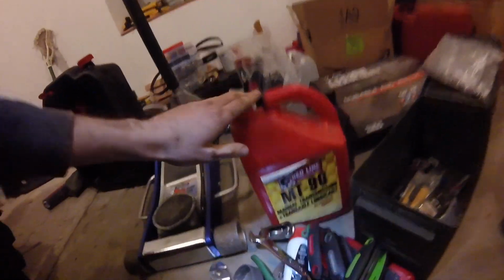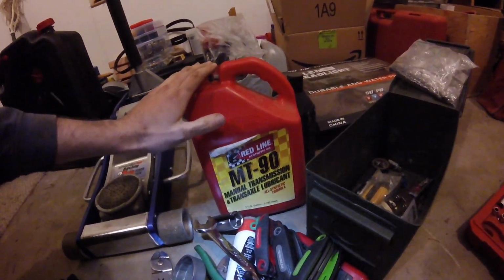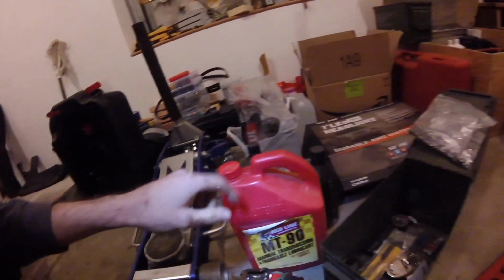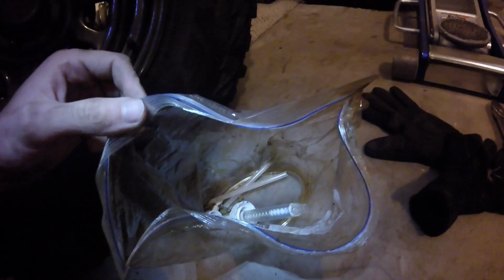So I'm using Redline MT-90. Also, I'll include in the description the part number for the MOPAR fluid. And so basically you're just going to drain it, pour it into a catch can, and then fill it back up, and the only thing you're going to need is a bottle pump right here. So that's going to screw onto the lid of that, and then we can pump the new fluid in.